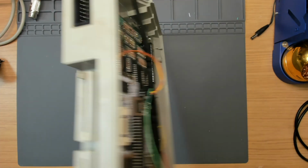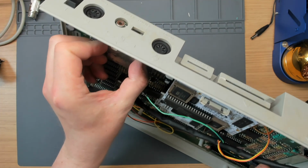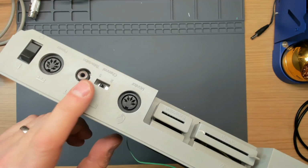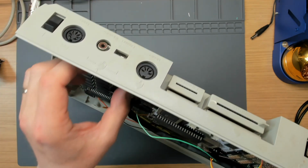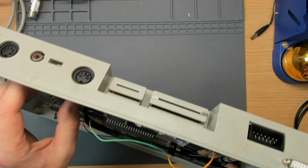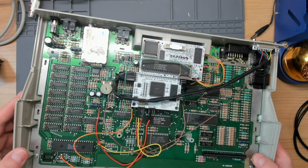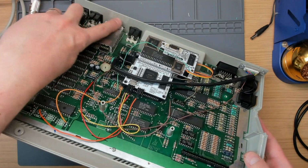Normally the thing I like to do is to take the RF modulator out and put the video jack there. And if you've been watching my channel for any length of time, you'll know that I usually use a DIN 13, as you'd find on the Atari ST. But that's fine. Maybe the customer wanted to keep composite video or something. It's a reasonable thing, because you lose composite video if you take the modulator out. But then again, you could have put the video connector up there, I suppose.